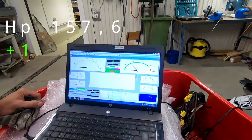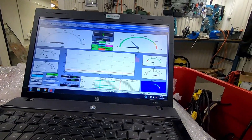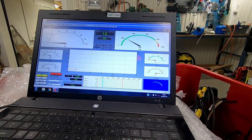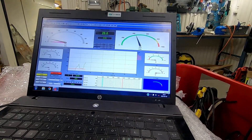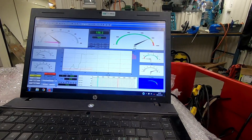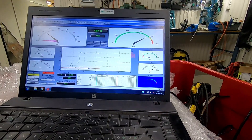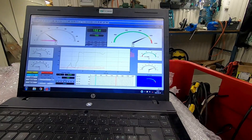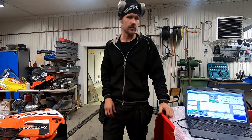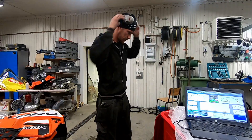We're going to look at the fuel just to see if we have something to gain there, or if we're in the same spot as last time. We are pretty lean actually, so I think we're going to add some fuel and see if we can get a little bit more horsepower. This is test number two for today — I only added some extra fuel because I think the engine was running a bit lean. So we'll run it and see what happens.